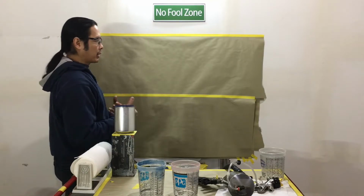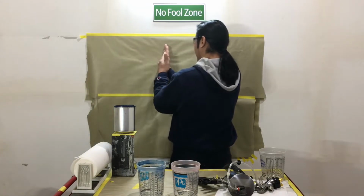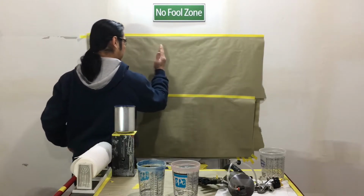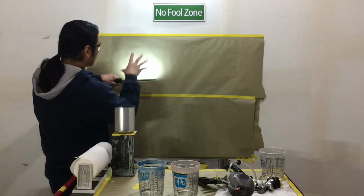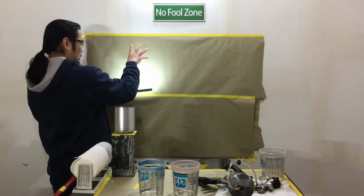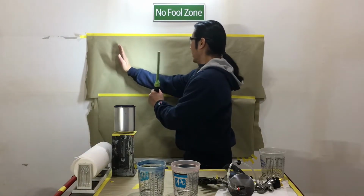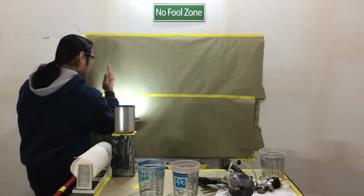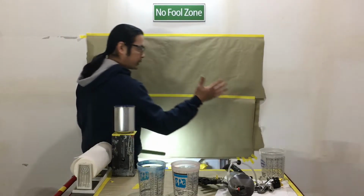I'm more methodical of a painter. I like to see what my panel is doing with the paint as it's hitting. What it's doing is I'm leaving it, seeing it there, I'm seeing it here, and I'm seeing what I gotta do ahead of time, right? So I'm watching and I'm looking. And if you notice, I'm always using a light or some form of a light so I can see the gloss. Or if you need a medium coat, I can see what that looks like on the panel. I'm looking here, I'm looking there, I'm looking ahead. So as I'm laying it down, I'm watching and watching. You can paint like this, boom, boom, boom, but are you really seeing what you're painting?